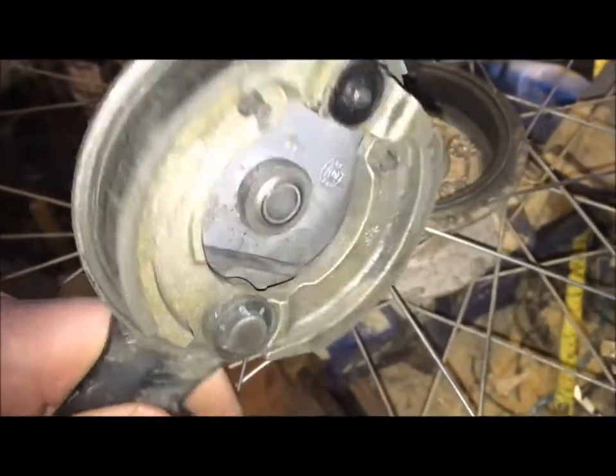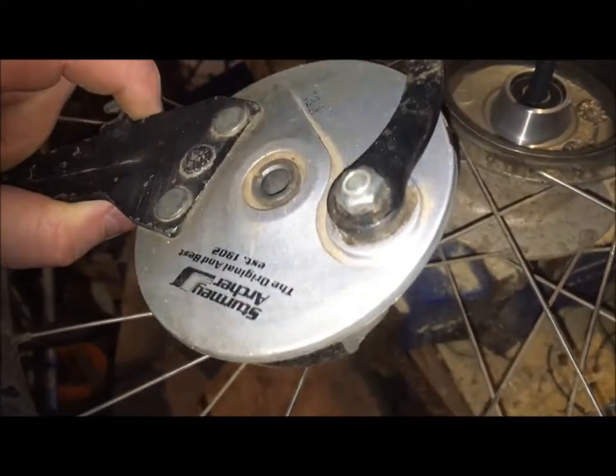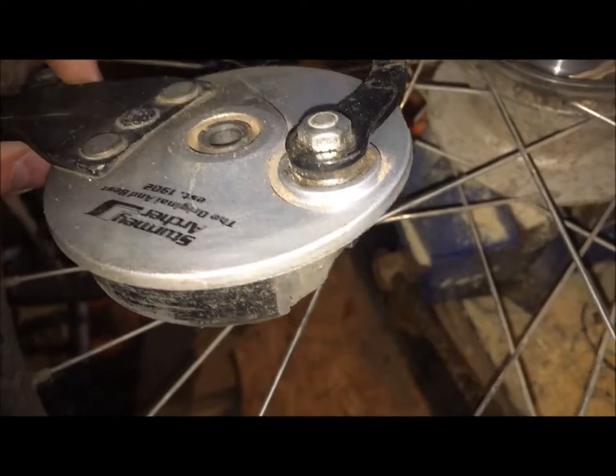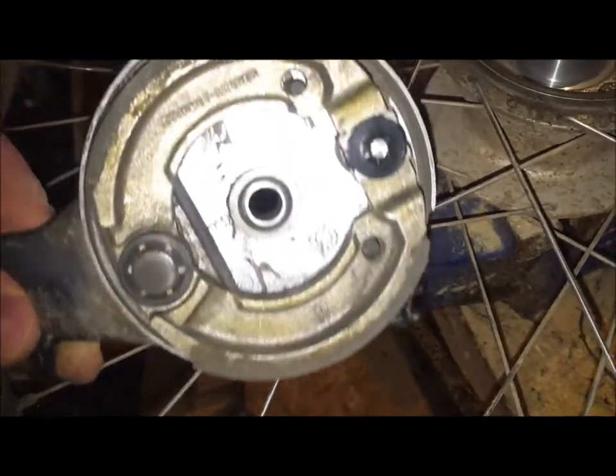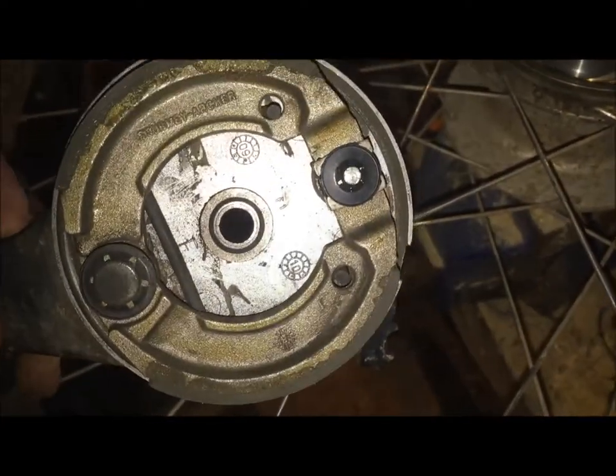Now I should say that forcing this upgrade is me being a bit idiotic and trying to take a shortcut. I sprayed some GT85, which is a PTFE lubricant, on that spindle to try and free it up when it was jamming. It tracked through and went all over the brake pads, which are now ruined, and despite cleaning them with brake cleaner, it hasn't done any good.